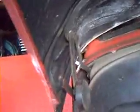When we're taking the hood hinges off, we're going to loosen this one bolt, because this is slotted on most, and when I pull the hood off, it'll come off. And we're going to unbolt it from the inside, not right here. It's a little more difficult if you take them off right there. You can strip these bolts and such. But if you take these off right here, the hood will still rest on there, and then you can lift it all off in one shot.